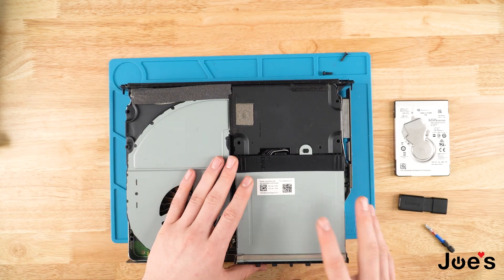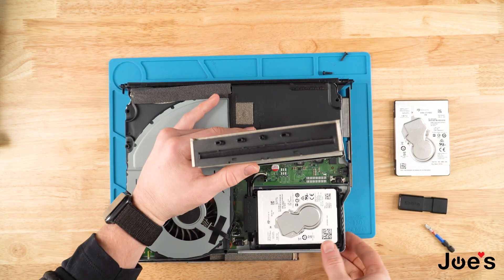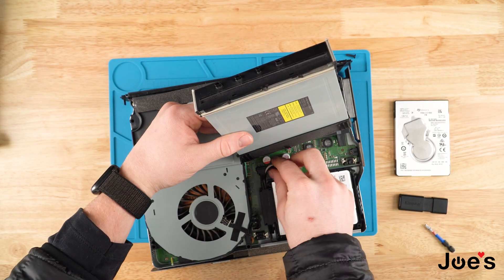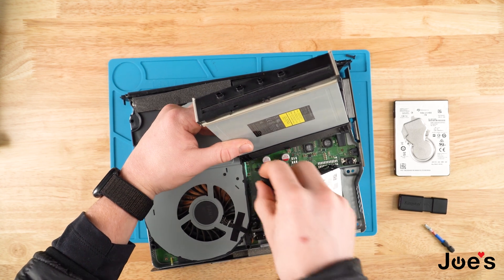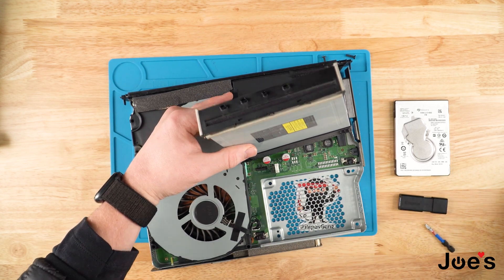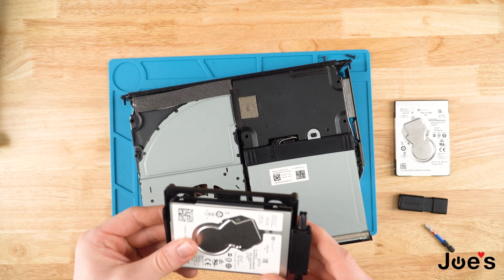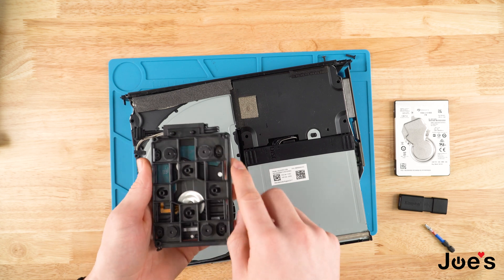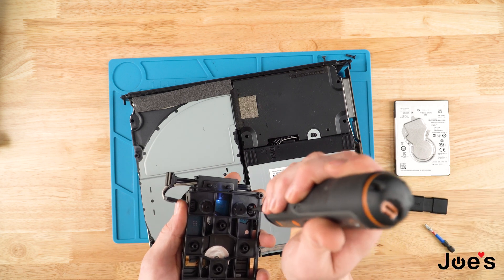The hard drive sits under this disk drive, so you can just pull up on the disk drive and as you can see there's a hard drive right there. You can go ahead and pop this off — pop off the SATA cable and put that to the side. Once you remove this hard drive you can go ahead and unscrew the four screws on the back side that actually hold the hard drive down.